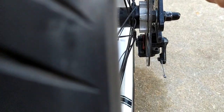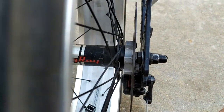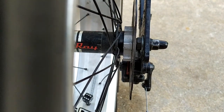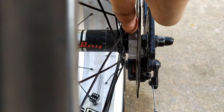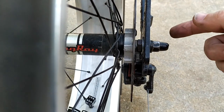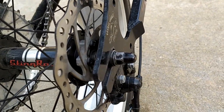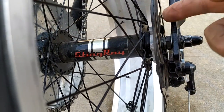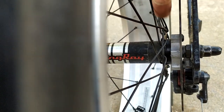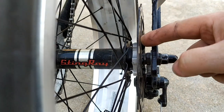If it unscrews, it jams inside the brake and you can't move. So I used a ton of thread lock, drilled a hole through the adapter, and put a screw through that hole into the hub to hold it there — otherwise you're going to be in big trouble. If that doesn't work, I'll drill the threads out, go around to the other side, and put a bolt to hold it. Five bolts hold the disc onto the adapter; one keeps it from spinning.